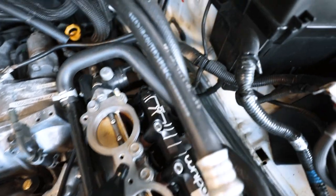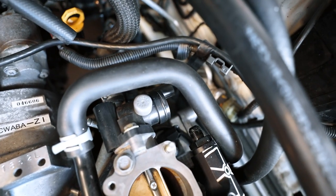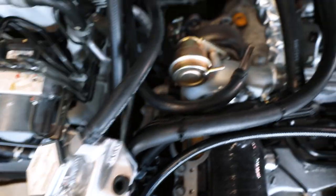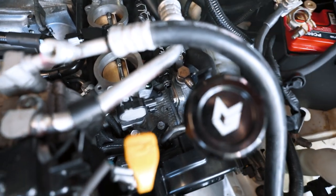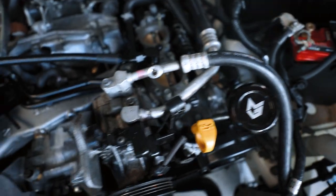As I'm trying to put this in and figure out where it's going to go around the TGV, this one's not too bad even though it's huge because it doesn't make contact with the connector. But on the other side it's right next to that connector in the exact same path. I test-fit and put the connector on — I have enough room to get a 180 off that, but on the side where I've got everything connected, I need to go under it, over it, or use a 90, and if I put a 90 off there the fitting is directly in the way. The fitting itself is actually right in the way instead of just the metal part of the hose.